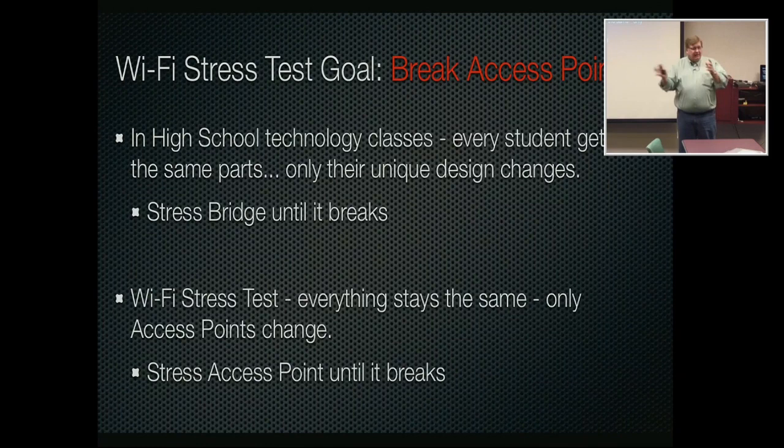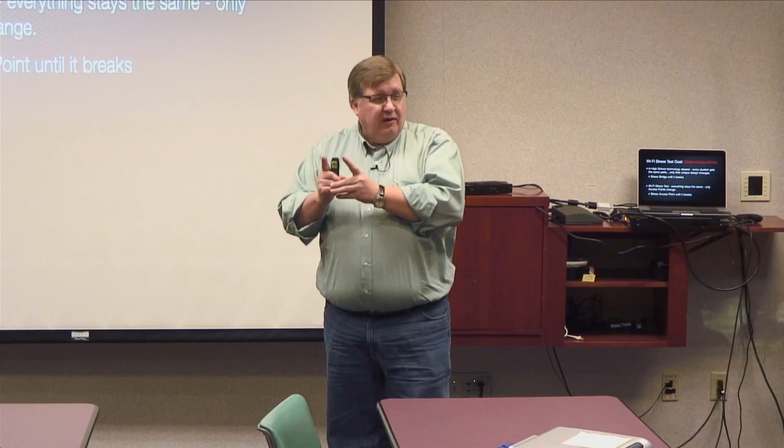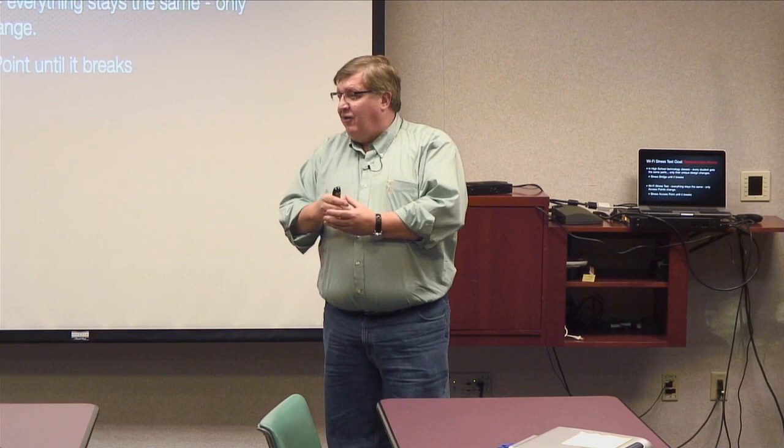the same 30 iPads. They were in the exact same place for every single test. The APs were mounted in the same place. The room was the same. The channel was the same. The frequencies were the same. The bandwidth was the same. The only thing we changed was the AP. And just like the bridge, you wanted to find out how long you could go before it broke.